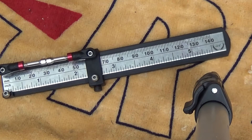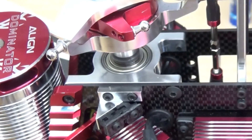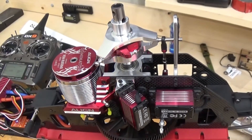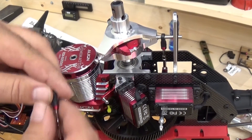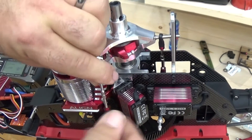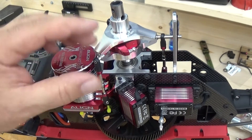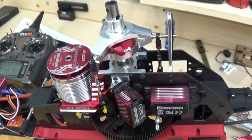You can ignore the markings on the actual duplicator — they don't take into account where the ball link ends are. But using the digital caliper, we're able to see we're at 59.5 millimeters end to end. We reconnect this, and always the A is going out. I've got to turn that slightly to connect to this servo.